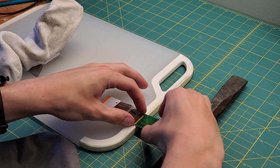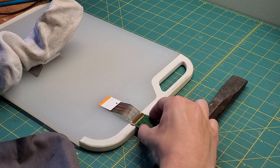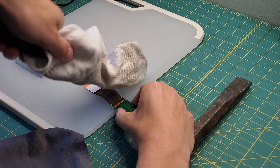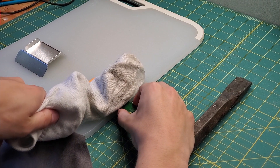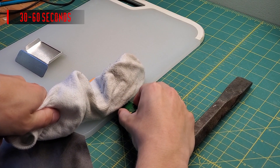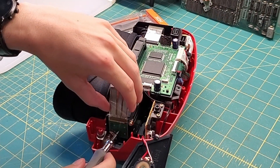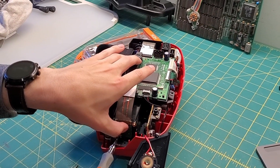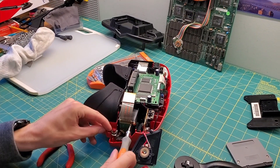While the iron is heating up, set the lens on the edge of the cutting board with leads facing up. Be careful not to smudge the lens if possible. When the iron is all heated up, gently press it evenly over the connection and hold it there. Try holding for at least 30 to 60 seconds, applying just a little bit of pressure throughout. Put the lens back in its place, reassemble, and test if it's working. There's a little bit of trial and error here, so if you don't see the results you want, try and repeat the ironing steps.